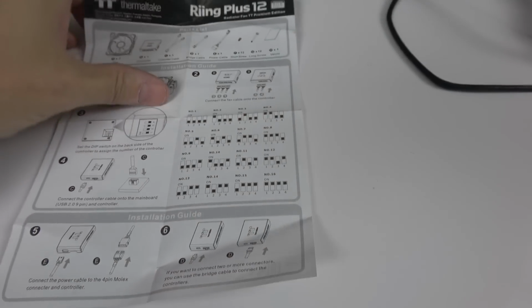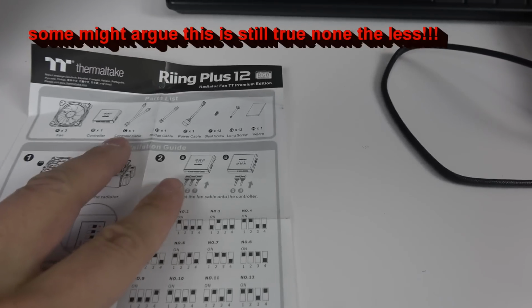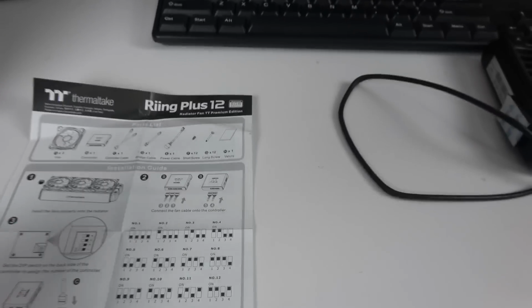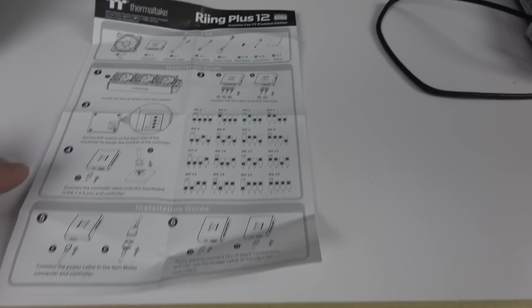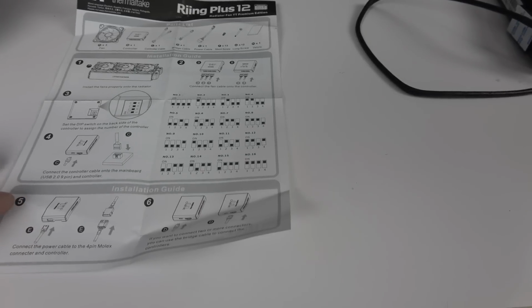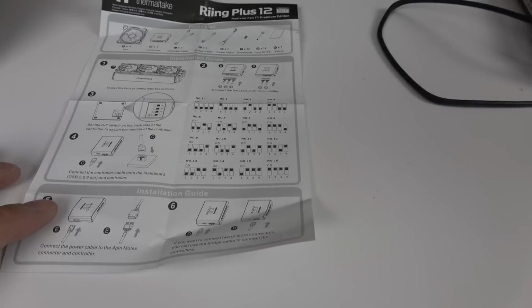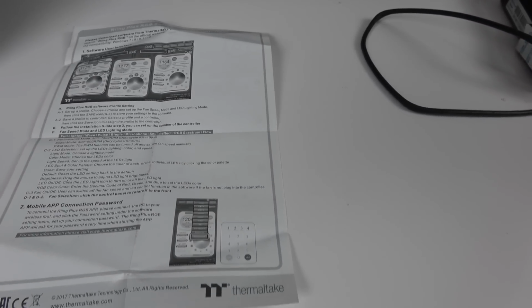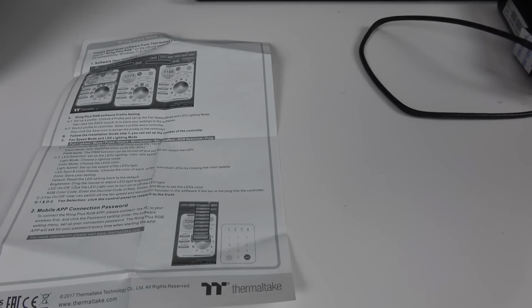The last point I'm going to make here: I also wanted to talk about the bridge. I had a hard time with it, and I thought, oh man, I'm stupid, I cannot see it. But you know what? The controller here says bridge cable D. But this is where I went a little too fast. If you look in the instructions on that sheet, nowhere does it talk about two things: how to use the bridge, how to connect it, and how to connect the water block. It's USB 2 type, and now we know it goes into the fan controller, but it doesn't say anywhere in the instructions. So a lot of people will not know, and they will go too fast. Obviously the pinout is different, from RGB to what it is on the USB 2 pins on the motherboard, which are not RGB, so obviously the pinout is different.